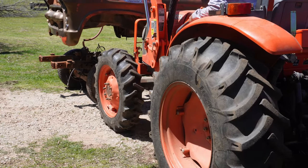So one of the subscribers wanted to see how the International set was kind of setting outside on level ground. Now the only thing I've done to that frame is I've lowered the front torsion bars down quite a bit. They're still not bottomed, but they're down quite a bit. I'm actually liking the way that's going to set once I kind of run it around, the front end settled. So what that's going to mean is I'm going to have to cut the bump stop off this thing so that I get a little more suspension travel in the front. But I am definitely happy with that. Let me go get back in the shade.